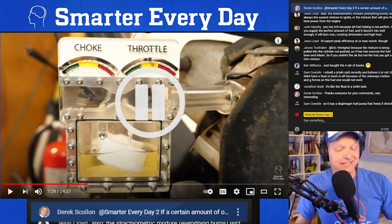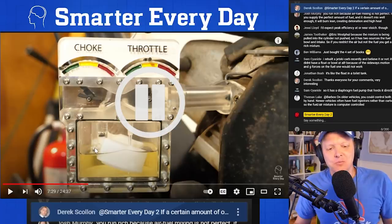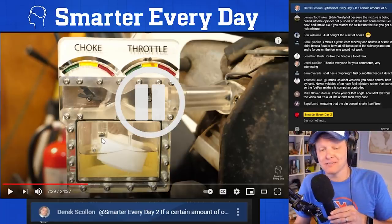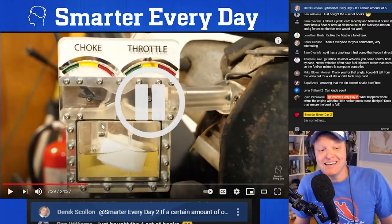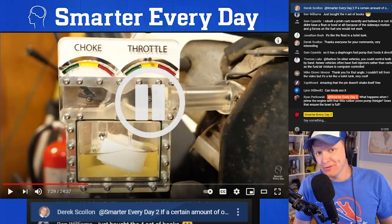The problem is we made this post. Trent designed that post based on something he measured with calipers. When he got that offset, there was a little bit of binding there, not on purpose. Depending on the quality of the print and if there was a little support on the Formlabs print in there, it's not ideal. So it rubbed a little bit. When we did the first load, it didn't go all the way up and seat. It actually bound, and so we overfilled the carburetor and had gas over the float.